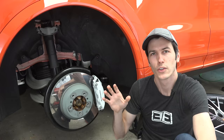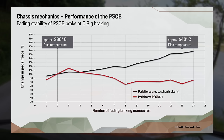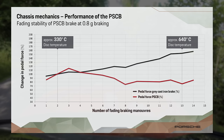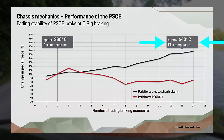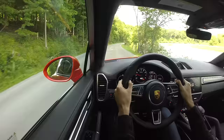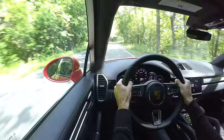What's really impressive about these rotors is that they maintain much more stable braking pressures than cast iron rotors. Porsche provided a graph showing the increase in pedal force required as the brake disc heats up — done with 0.8 G braking, applying stop after stop. After two hard braking instances the brake temperature is at 330 degrees, rising all the way to 640 degrees by the 13th braking maneuver. The cast iron rotor continues to require increased pedal effort each time, meaning the driver has to push the pedal harder and harder.